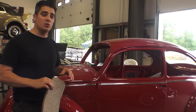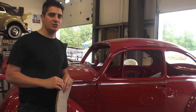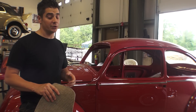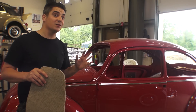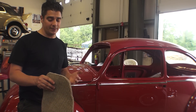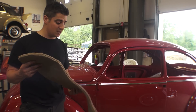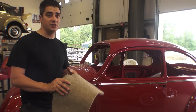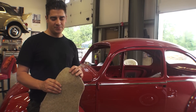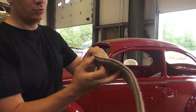To be honest, you don't really need to put anything else down in the luggage area if you don't want to. The Quick Roof in general will stop the vibrations and really deaden the sound. And then when you put the carpet on top of that, that's pretty good. But if you want to go the extra mile and maybe even prevent a little bit of smell — which I still haven't had — if you think there might be a smell, maybe you live in a really hot climate area, there's carpet padding material that either Wolfsburg West or CIP1 sells.